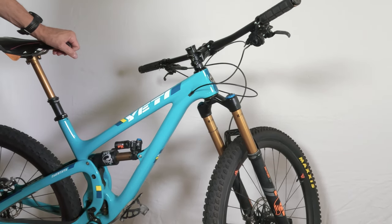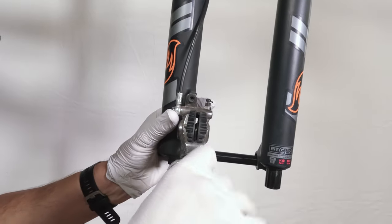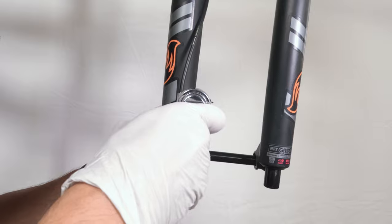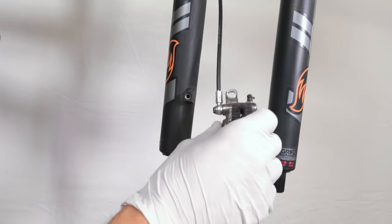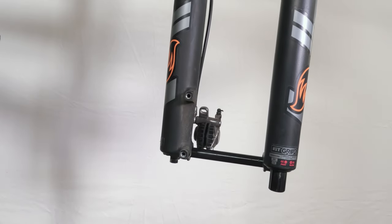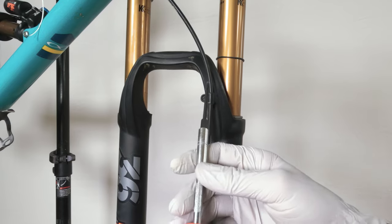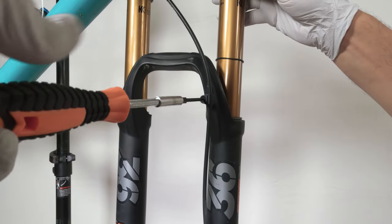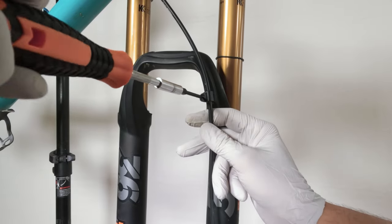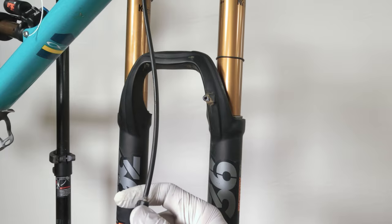With all that being said, let's get on with the job. I'm going to start on the bottom with the caliper and work our way up. In this case, I have two five-millimeter Allen bolts, so I'm going to crack them loose — do the bottom and the top. That's two bolts, same size, and our caliper is off. Next, let's work on the cable holder. Now, this you have to be careful with — it's a pretty weak bolt. When we get to installing it, you really have to be careful not to strip the threads in the fork. We take our two-and-a-half and remove the bolt from the lower boot, then leave the bolt in the plastic — no need to remove it.